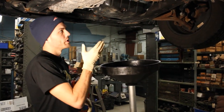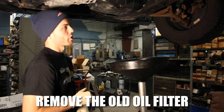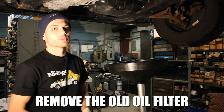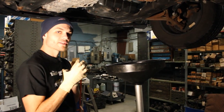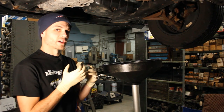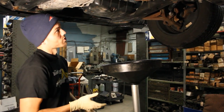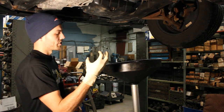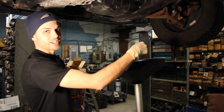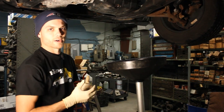Once you have drained most of the oil, now it's time to take out the oil filter. Make sure your pan is still under that drip if there's still oil dripping — if not, you can put the plug back in. I'm going to let it continue to drain while I take the oil filter off, which is located right near the drain plug, just up a little bit further on the 2.4 liter engine. Most of the time you can get two hands on this and just loosen the filter — it threads off to the left, just like a normal bolt. However, it's a big filter, so you might need an oil filter wrench for extra leverage. When you pull it out, the bottom half of that filter is actually going to be full of oil, so you'll have to dip it down into your pan and release all the oil from inside the filter. Just be aware it will drip.